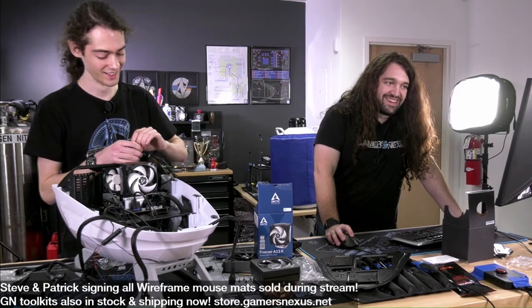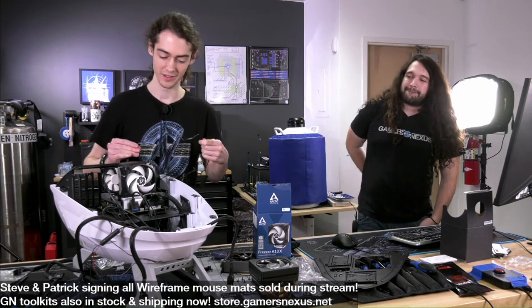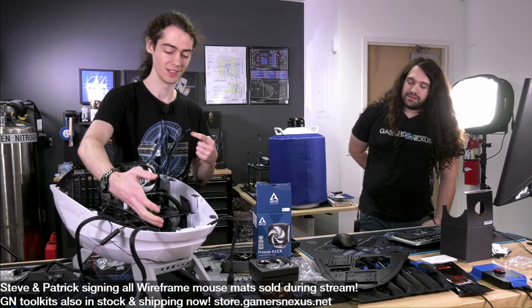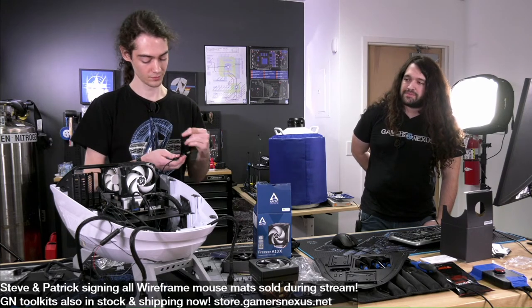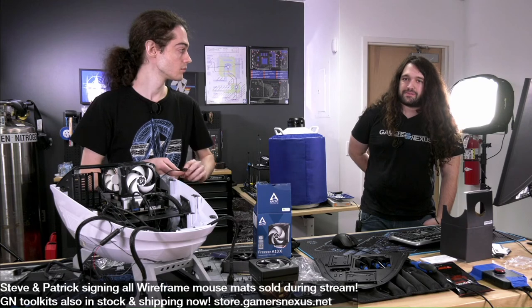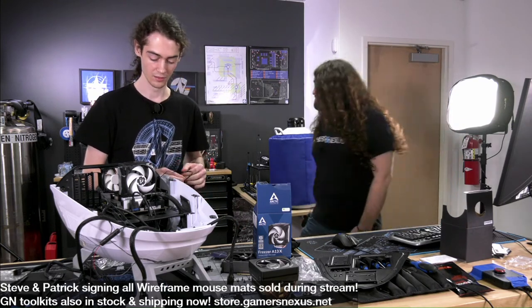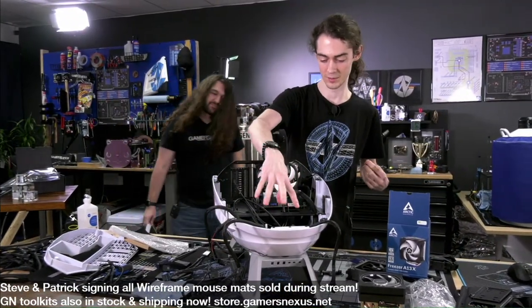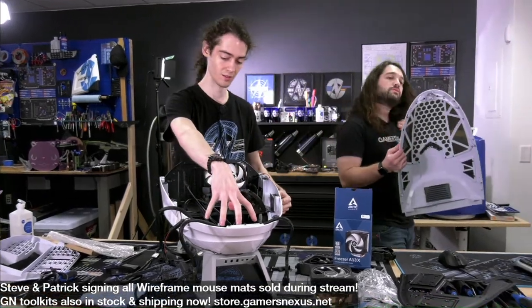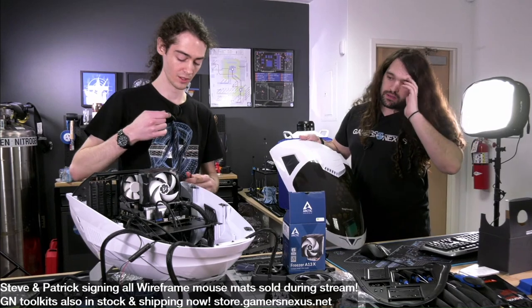Let's see. I wonder if you can water cool this case, JP Renoir said. No. Yeah. There's one mount where you could put a 120 radiator theoretically, and it's like fully inside the case body. You'd have to modify it for sure. Like to get a pump and a res and everything in there. Yeah, and if you used a CLC, then your CPU block is above everything. It's at exactly the same level as the reservoir. I mean, radiator, you'd just be running the tubes that way.